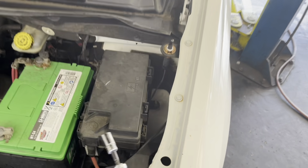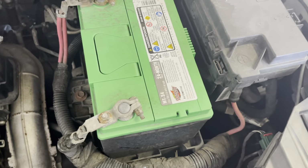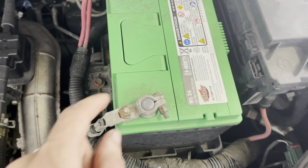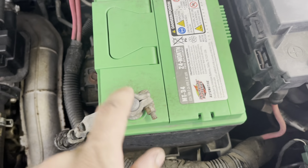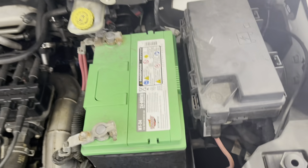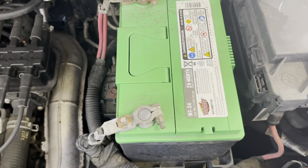Reminder that step 1 of every single electrical diagnosis procedure ever for every manufacturer is check battery terminals, make sure that they are clean and tight, and that the battery is making a good connection. So without doing that, there's no chance of doing a successful diagnosis on anything else. So anyway, I'm going to remove this stuff while my new terminal ends are on the way.